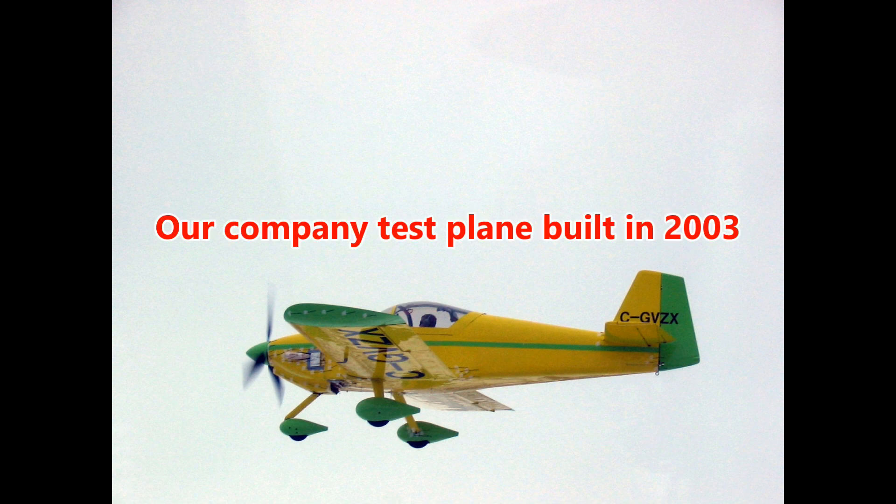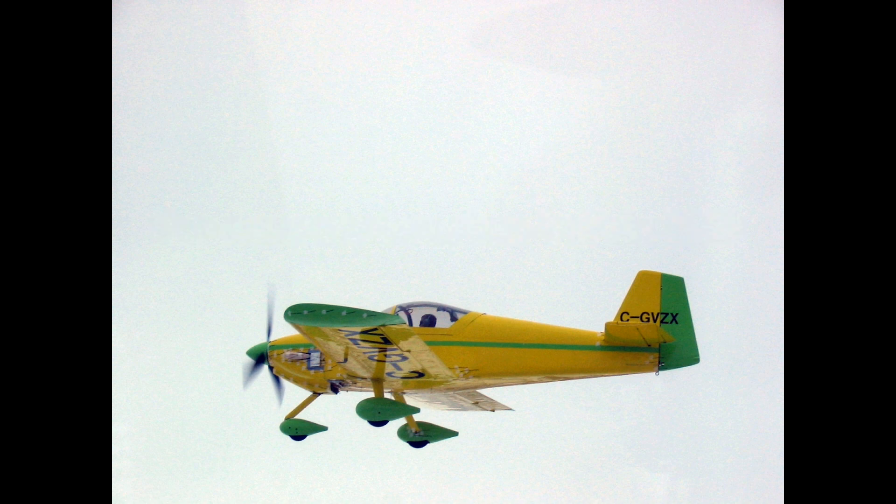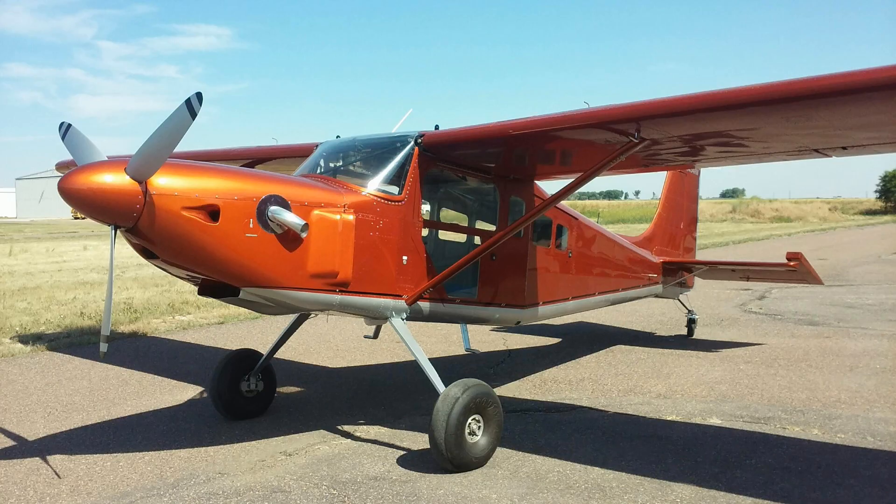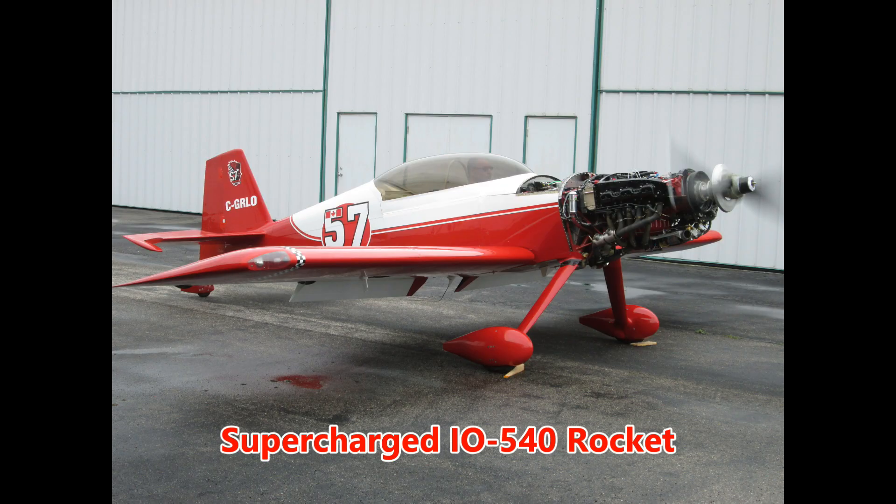The main reasons people replace old mechanical fuel injection, carburetor systems, and magnetos with EFI are: reduced maintenance, probably a little better fuel economy, smoother running, the ability to trim individual cylinders in flight, better cold starting, and elimination of hot start problems — which are pretty common with Bendix mechanical type fuel injection systems.